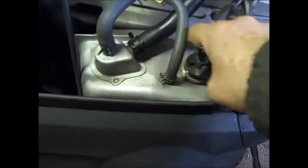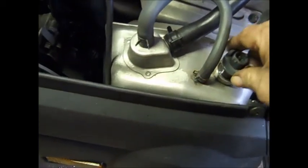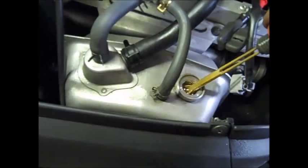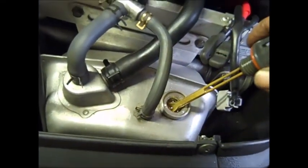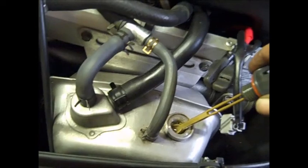After that you're set to go — start it up, let it run and warm up good. The book says to drive it around for a short ride. Then unhook the little electrical wire off the top of the dipstick, pull the dipstick out, wipe it off, then set it back in without threading it at all — just set it right in there — then lift it back out to see what the oil level is.